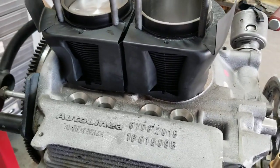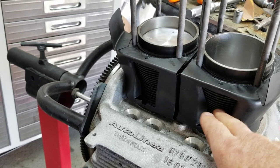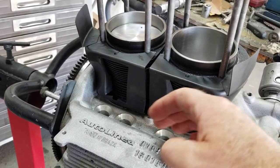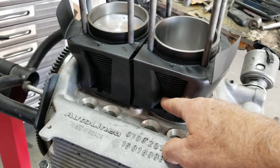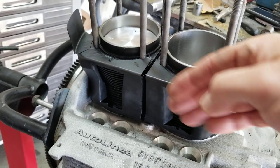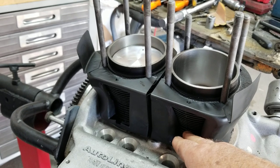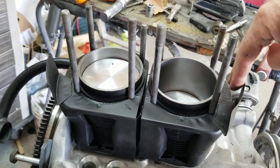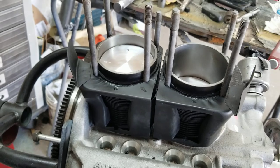What these do that's better than the other is two different things. They meter the air that comes through your cylinders, so none of it is wasted. It all has to go through these holes. That gives the maximum amount of cooling, with no wasted air going around your cylinders, so no part of your cylinder is not getting air. The second thing is, because it meters the proper amount of air going through here, it allows more air to go through your heads, and also helps air go all the way around the combustion chamber of your head here and go out this area and out the back of the car.